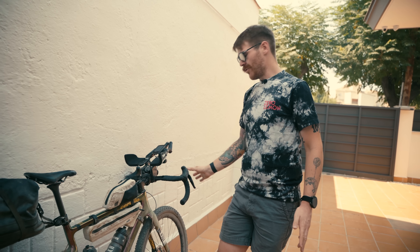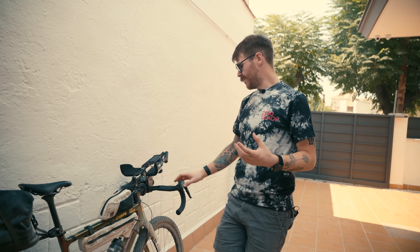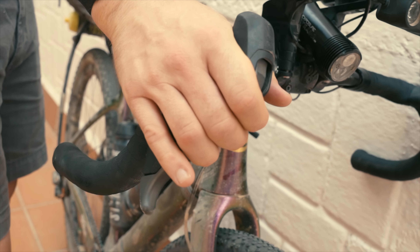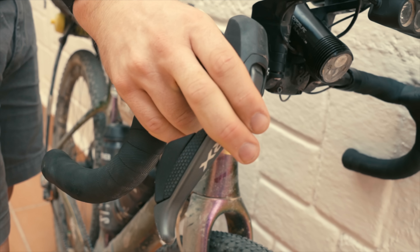The shifters are Shimano GRX Di2 — 100% my favourite shifters. They're really ergonomic. I have quite bad nerve damage in my left hand and can't grip properly on a lot of things, but the shape of the GRX hoods lets me lock my hand in, with plenty of room to get two or even three fingers under the hood to brake without major contact issues. The pivot point is slightly different from road shifters. I've set it up so both left and right shifters control the rear mech up and down the cassette, and the inside buttons also control the rear mech — right going to a harder gear, left going to an easier gear.